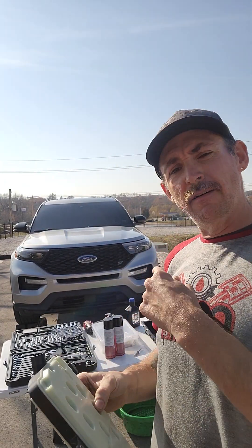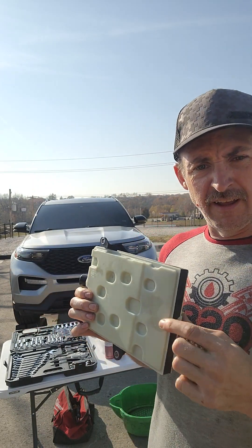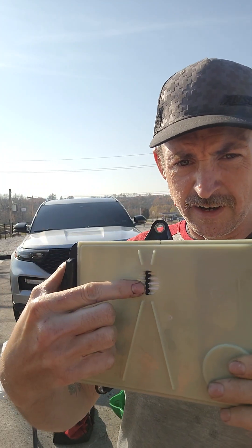If you get this upgraded filter, you end up with two magnets in the pan and one in the filter — so you get a third magnet total. That's the big upgrade. This filter really comes down to price and availability — we can only source about five or six at a time. The filter media inside is identical; we've cut these open and inspected them. There are two rows of synthetic media and then regular filtration — this is not a screen, there is in fact a filter inside, just like an oil filter.